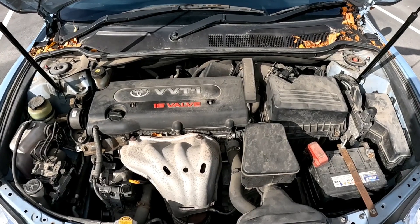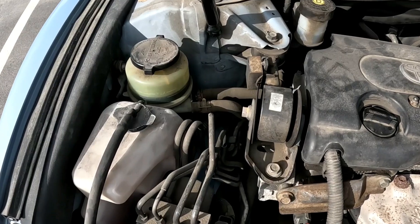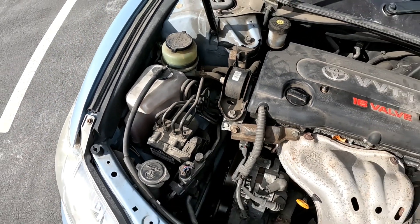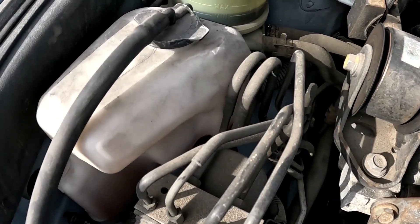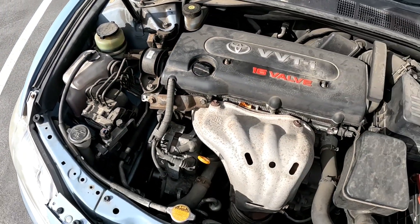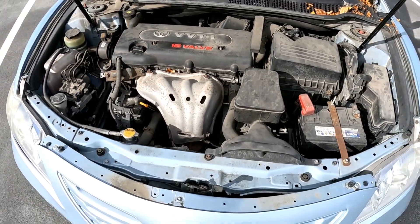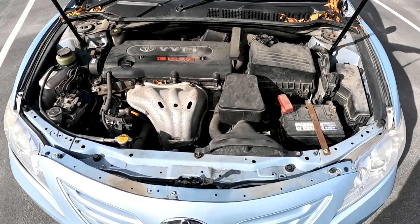If you're going to drain and fill your cooling system, it's not a hard thing to do. All you need to do is open the expansion tank cap when it's cold, refill it with coolant, start the engine, and let the water pump suck the coolant down. The air will surface and you just refill it to the desired level. I hope this video has been useful and informative — consider subscribing if you haven't already, and I'll see you in the next one.